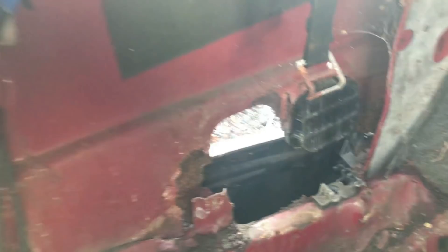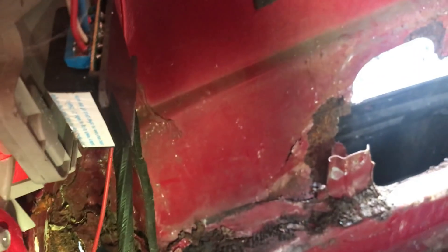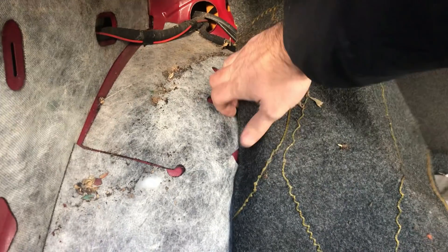Here we have the boot floor. I know this is a common spot — these vents just go, and you can buy that repair panel for Omegas and Senators, so that's not too difficult. I just wanted to have a look at the actual wheel wells and suspension structure because I'm more concerned about suspension hard points than I am bodywork. These tops both look okay on both sides. I thought I'd excavate my way through the rest of the boot, get all these carpets up and have a look, so I shall do that and report back.